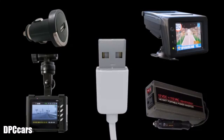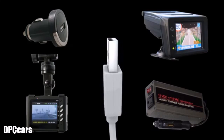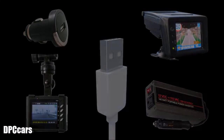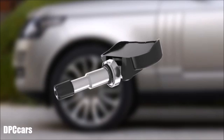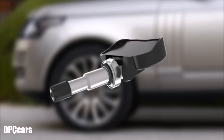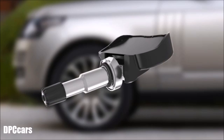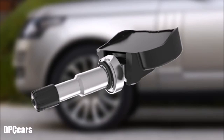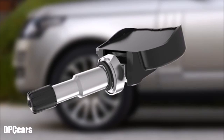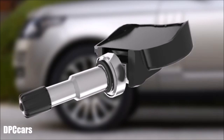Fitting non-approved accessories, for example USB chargers, may interfere with the system and cause a fault message to be displayed. These can interfere with the TPMS wheel sensors and can cause intermittent TPMS operation or non-function. Remove these items and observe if the TPMS fault message disappears. Under these circumstances, the TPMS may not detect if a tyre's pressure is low.